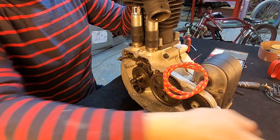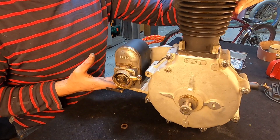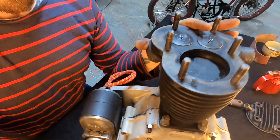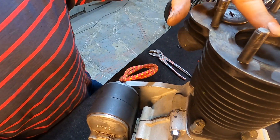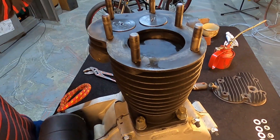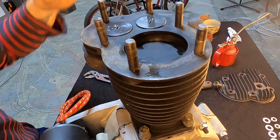I have to move four teeth from the factory sign on this gear to get to a decent spark position, spark timing. In fully retarded, the spark that I have is now one millimeter after top dead center, which is good — it will never throw back the pedal. And fully advanced, I have around 15 millimeters from the top to the piston.